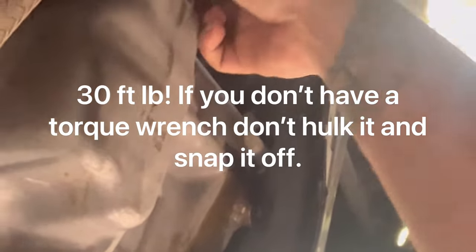Take our plug and put it back in. Torque specs will be in the description. Remember guys, if you don't have a torque wrench — most likely if you're doing it yourself and don't normally work on stuff, you probably won't have one. You don't want to put it on as tight as the last one that I was busting off. Get it kind of snug, and then like one more little eighth or quarter turn — and that is good enough.